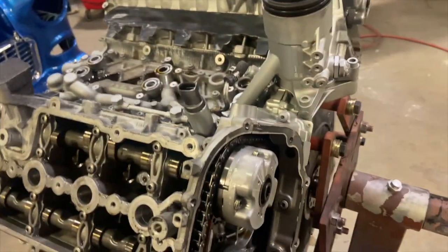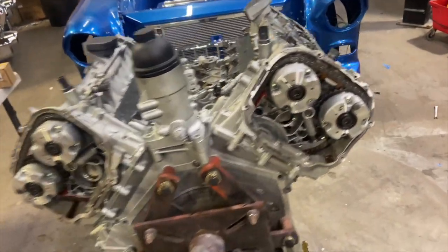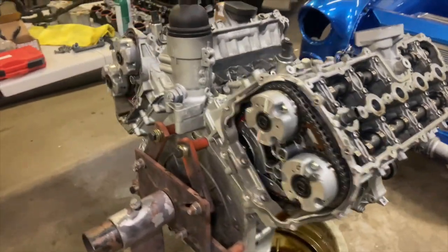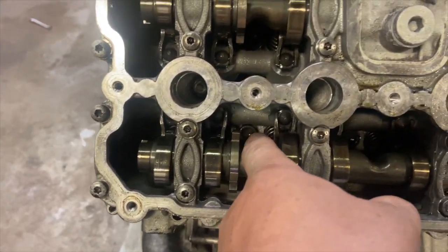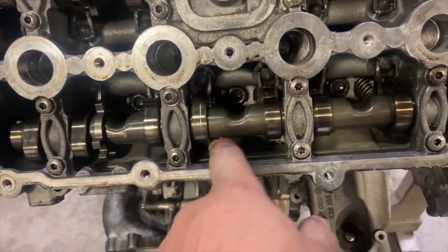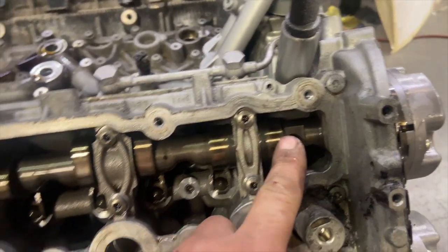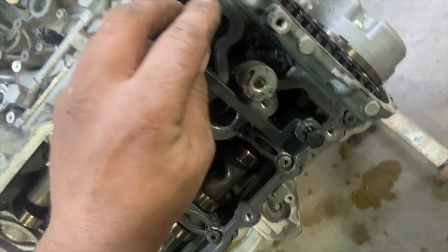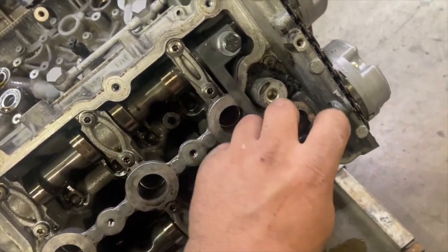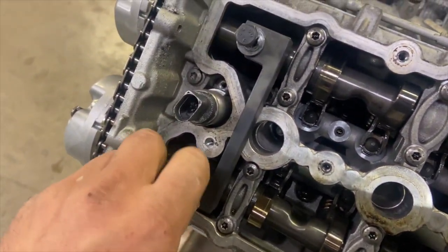There are tools that lock the cams in place and a tool that locks the crank in place. I've rotated the engine around — it's crazy how this one's made. The cam itself is notched out for all the head bolts, physically machined and cast that way, but at the very end there are threaded holes too. There are cam fixture tools that bolt on and hold the cam from rotating when you take everything apart — one for each side.